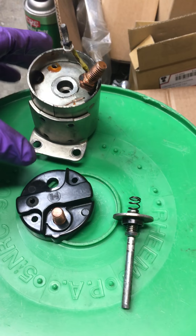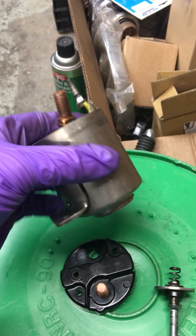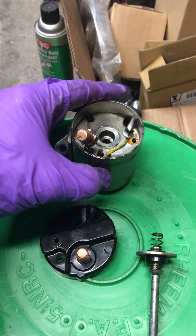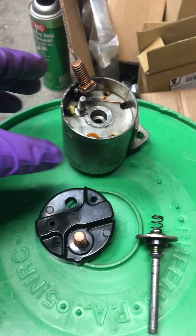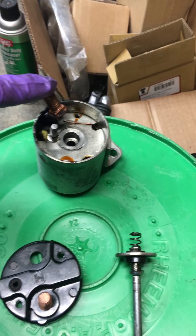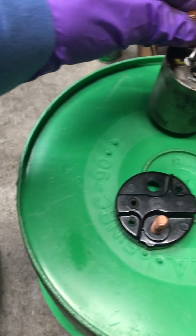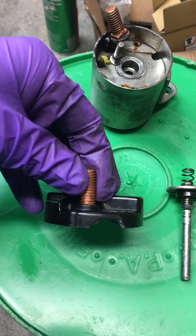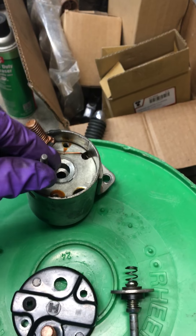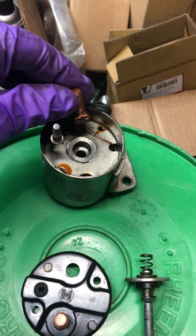This is a quick little video on a Harley starter solenoid — it's a real good little trick actually. I took the cap off of it, so both this stud and that stud were double nutted. The battery goes on the longer one here, and this is your starter solenoid wire that triggers the solenoid, and this is the output.